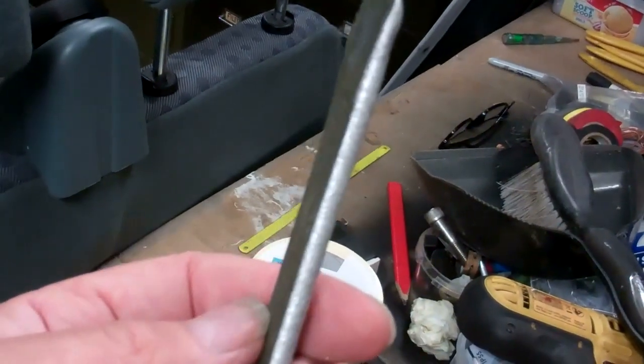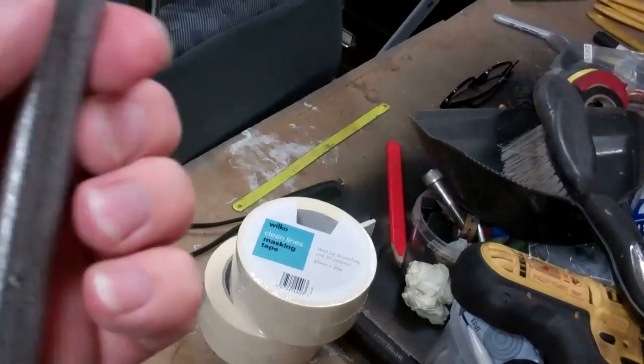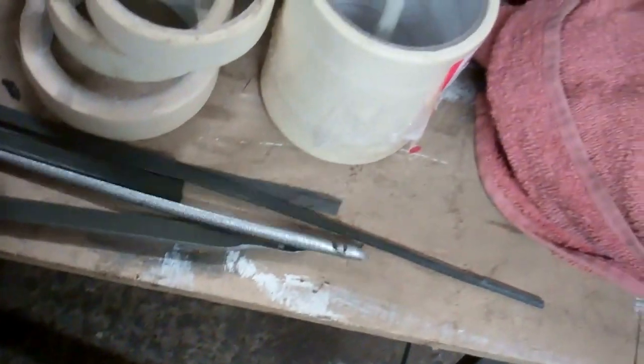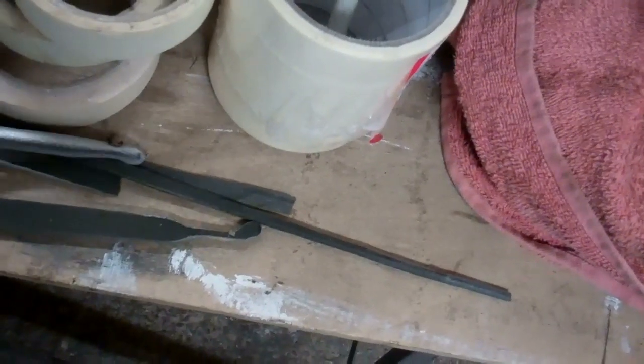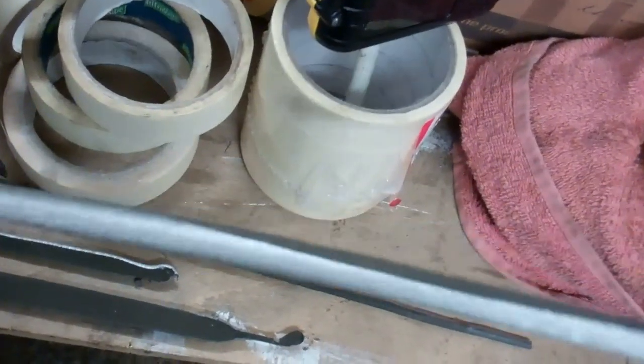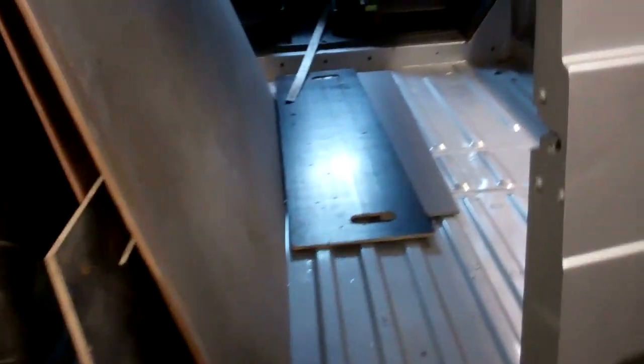Now this is panel adhesive. You can see where it was stuck to one side of the panel, and that was stuck to the other side. So I've gone along with the knife and I've cut all this out. Like I said, if you don't cut that out, it makes your rubber trim really difficult to fit, and it can sprain the wire because it's in a U shape, and it can sprain that grip that it has. So I've done that. That's all cut out.